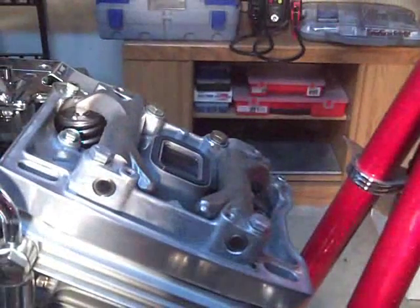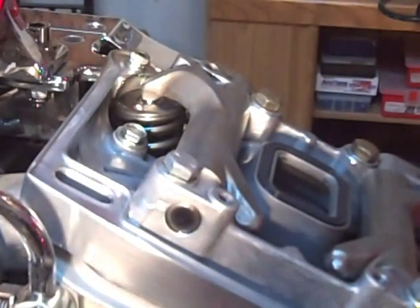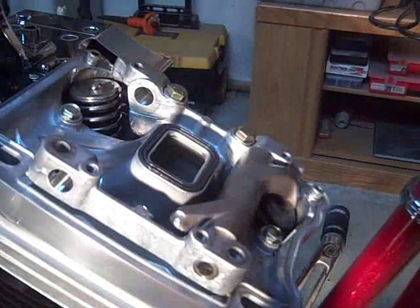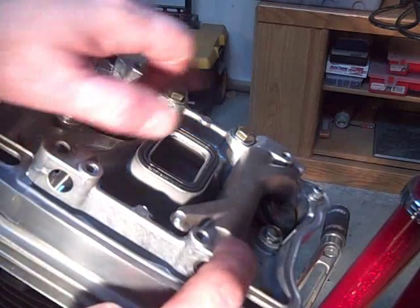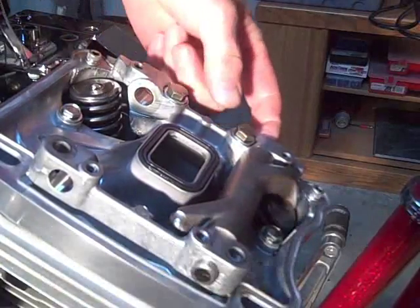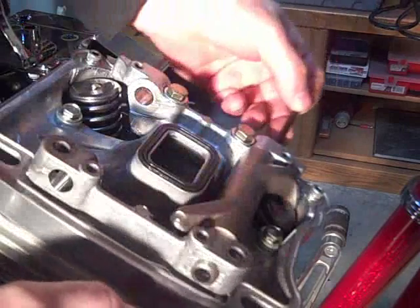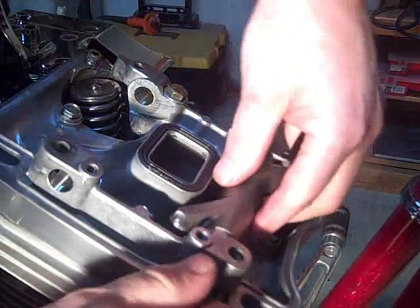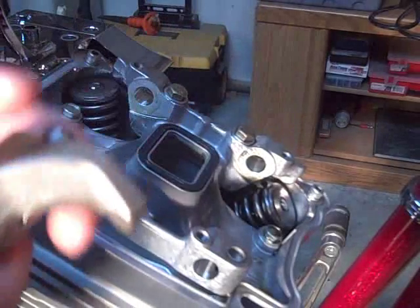As you can see, I've taken the tank off of my little beauty, and I've also removed the rocker box cover. Unfortunately, I'm going to have to take the rocker arms off to get this together. After removing the top cover bolts, taking the top and the spacer out, I've removed these two large rocker cover bolts that are underneath, and your shaft should slide right out. There's a notch in here on the side, and that cover bolt keeps this from turning. I'm going to remove that — everything looks good. Slide that back in and put it away.